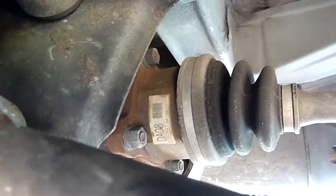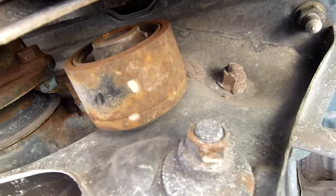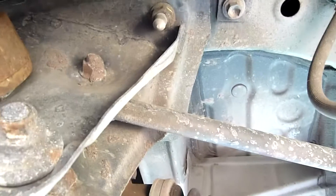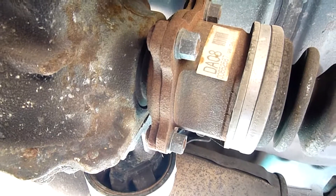Nothing else is needing maintenance - it's not leaking through the pinion seal, it's not leaking from the drive shaft output seals, all the common places where these do leak, it's not doing it. So I'm not in any particular hurry to take it out and disturb everything. I'd rather just leave it as it is, even though it's all flange mounted drive shafts - that's pretty straightforward, just take the four bolts out and away you go.